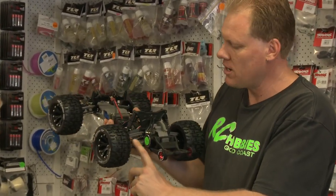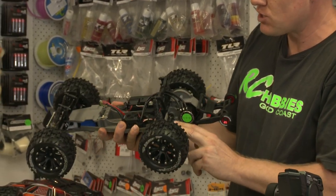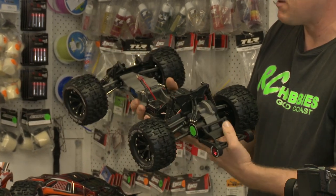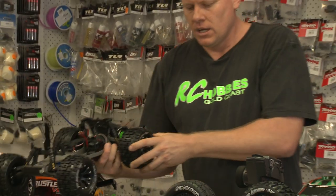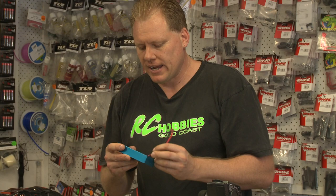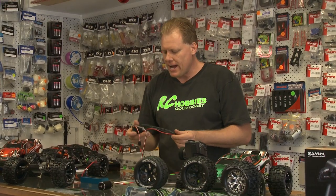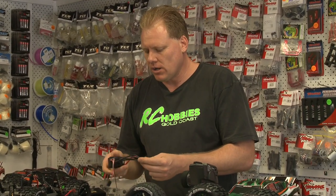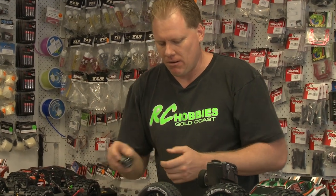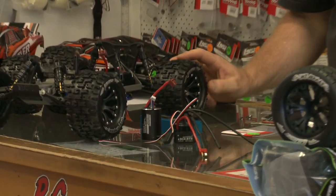The car runs four-wheel drive axles — we include the four-wheel drive axles. Standard they run a small 1951 axle, but these have got the four-wheel drive axles you'd see in a four-wheel drive Slash, so much heavier in the axle department. When you buy this package, it will come with a lipo battery — we include the aluminium case lipo as standard. With the car you get the 80 amp speed controller, waterproof Hobbywing brand, and 4000kV motor with tons of power.